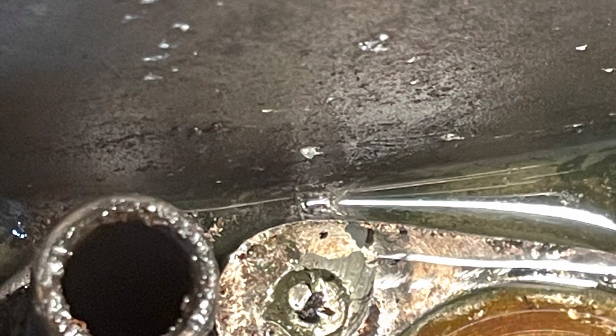We just took a slight break from working on the C3 for this. Young high school kid having problems with his truck. The younger people are wanting to get into hot rods, you know, even just getting their own ride going. So I had him bring it down and tried to extract the bolt. The bad part that caused them to get stuck was they had an easy out in the bolt, but it was halfway in the threads of the bolt and the manifold, so it kind of locked itself in place.